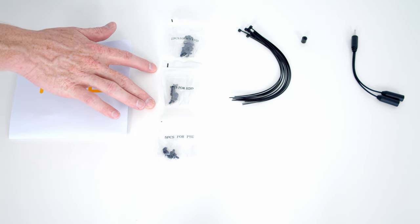Set the motherboard into the case lining it up with the standoffs — the middle standoff protrudes slightly to hold it in place. Secure with the labelled screws from the accessory box. The HD audio cable goes into the header at the bottom left of the motherboard, brought through the cutouts with the HD audio text facing up. The front panel connectors are combined into a single plug by Hyte — plug in with the label facing up, then pull excess cable through to the back.